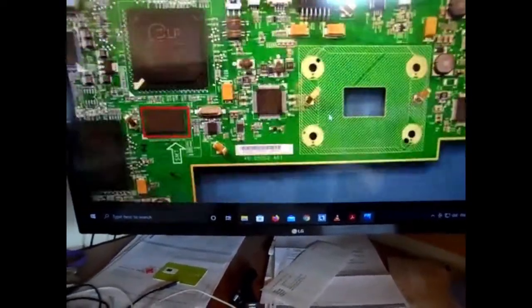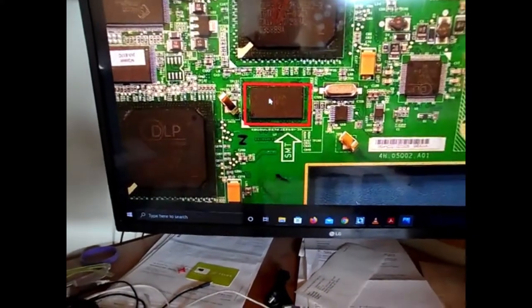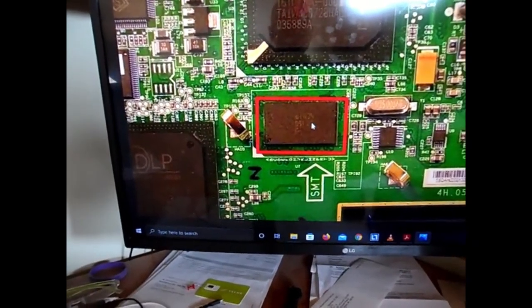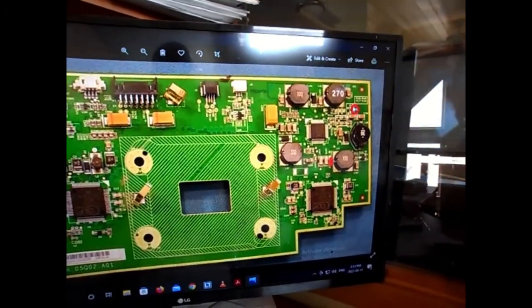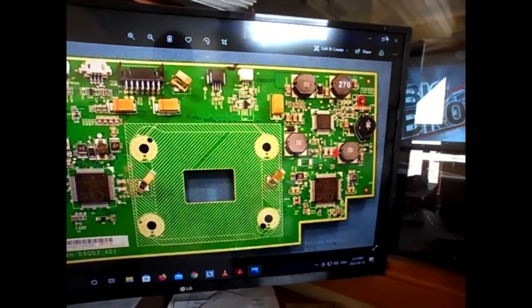So that's the board. Those are the two pins, and that will cause this big chip over here to fail. If this chip fails, well, you could replace it with very specialized tools and it would be very expensive. You might as well just forget about it. This little chip here, the 5-volt supply, I bought for 85 cents from Newark. I'll put the link to that part in the description also.